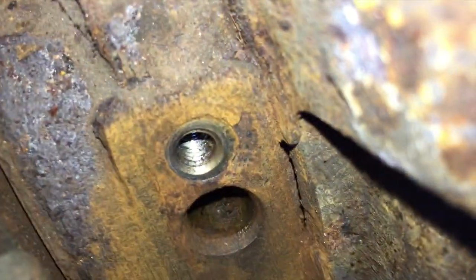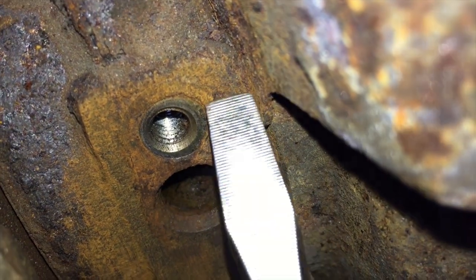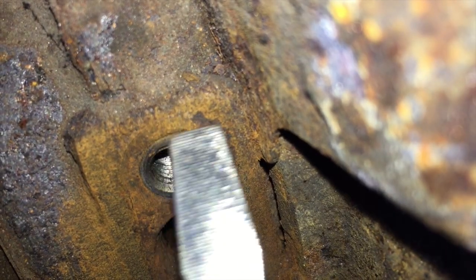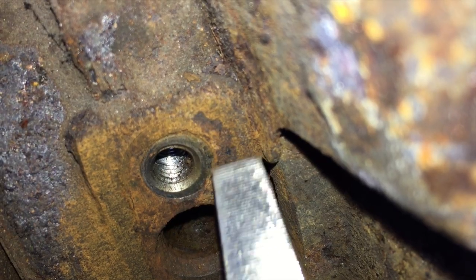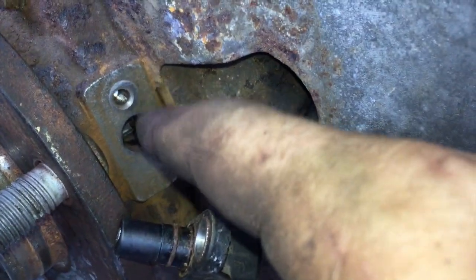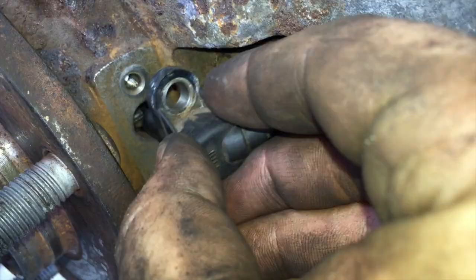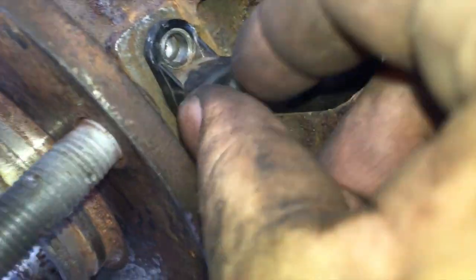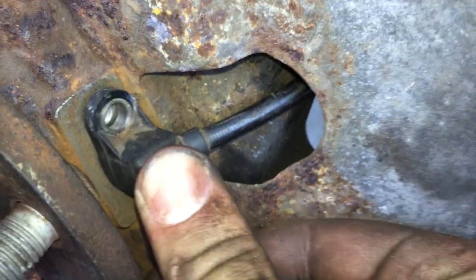I'm on the driver's side. I've got the wheel speed sensor off and you can see just how much scale builds up around the sensor — it's quite a bit. You can see where the good metal is right here. There's a decent amount of rust that's built up and scaled up underneath the sensor causing it to lift. So we're going to sand all this down as much as we can. I took my screwdriver and scraped off all the heavy scale, took a piece of sandpaper and sanded it down, cleaned off the sensor. It probably wouldn't hurt to put a little dielectric grease on this, but I don't happen to have any, so I'm going to roll the dice and just put this back in and cross my fingers.